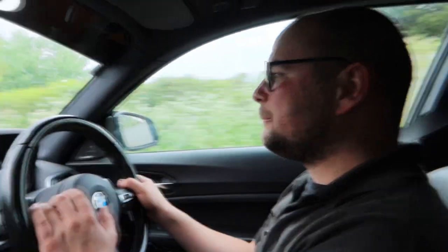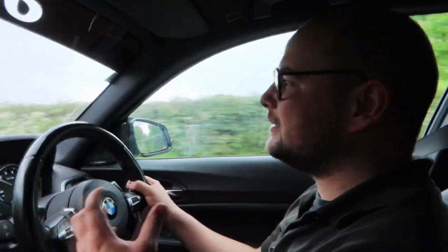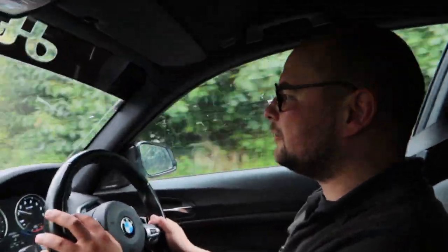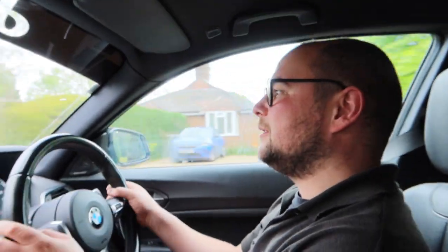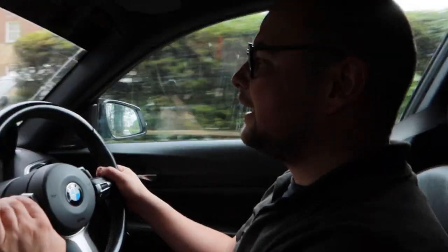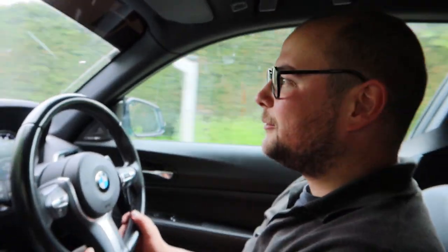What's next for us? We're pushing more power out of this thing, which will be all revealed in a future video. But as we're upping the torque and power, I think we're still overcoming the rear subframe bush issue — we're getting quite a bit of essentially rear axle walk. Going down the road, it's trying to steer the car sideways the whole time, which is dramatically better with those inserts, but ultimately what we're going to do is swap to a full Powerflex Black Series bush for the subframe bushes. We might see if we can throw a few other little tricks in there at the same time, and just really start to push this platform ahead of some track days this year. We'll catch you next time.